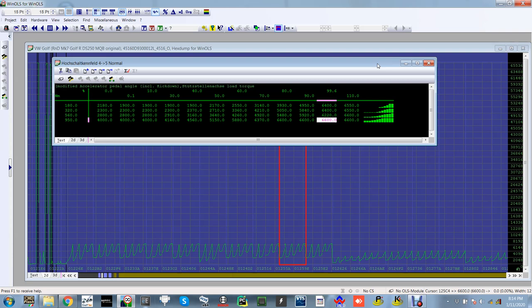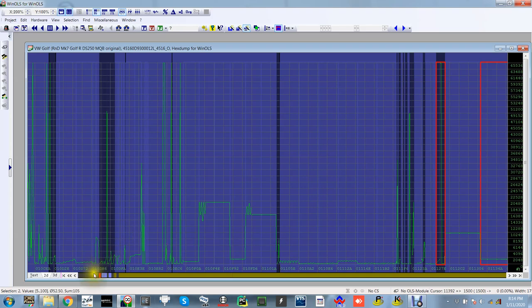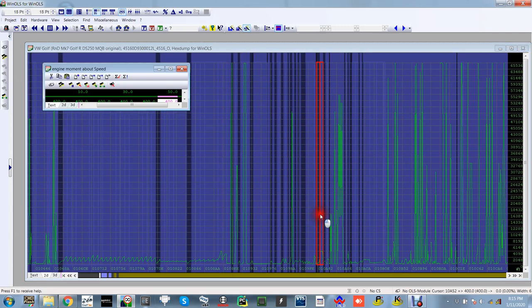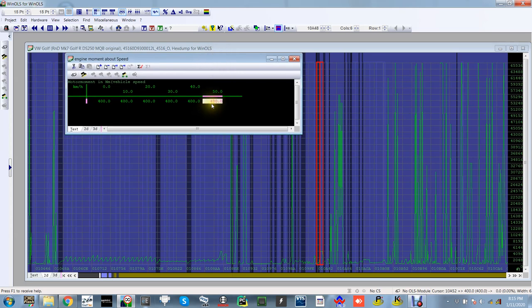You're now using your entire rev range from your tune, which is what you want. Also within these maps there are little 2D maps for torque limiters and similar things. You've got your launch control limiters — we can change those, ESP on, ESP off. Here's the torque limiter: engine torque based on speed, set to 400 Newton metres. So even if I've tuned the engine and it's putting out 450 or 500 Newton metres, the gearbox is still capped at 400 Newton metres, because the DSG and the engine talk to each other — they know where both of them are.